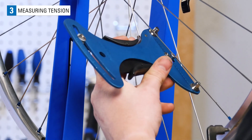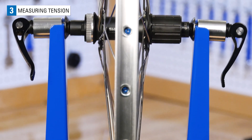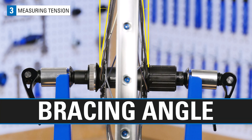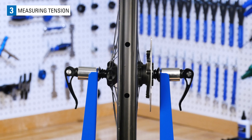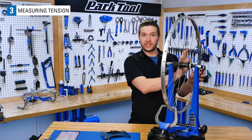When we check the left side of this rear wheel, we notice that these readings are lower than the right side. This is due to the fact that the spokes come out of the hub at different angles. The angle that a spoke leaves the hub is often referred to as the bracing angle. When the spoke has more angle, that means it has more mechanical advantage and will need less tension to counter the opposing side if the opposing side has less of a bracing angle. This is seen on rear wheels and front wheels with a rotor. Your tension goal applies to the side with more tension.